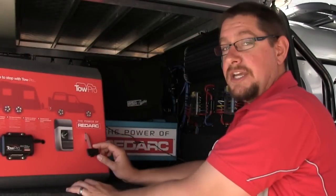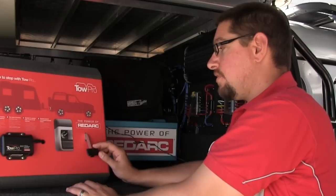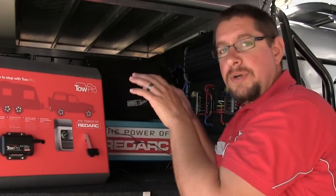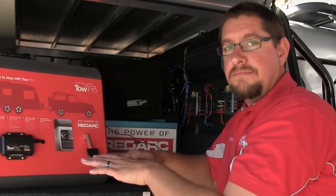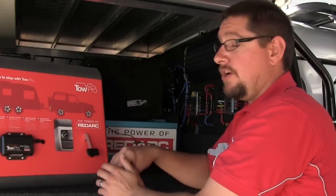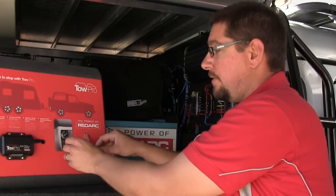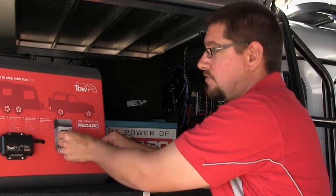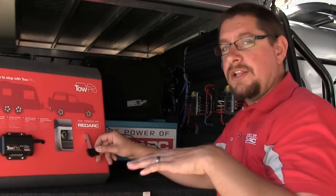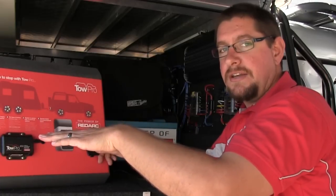In a soft beach sand driving situation, if we brake hard on soft sand, the vehicle bites into the sand. What we don't want is the trailer to bite into the sand as well, or we'll be anchored there. So we can set a very light amount of trailer braking force. You can brake as hard or as soft as you want with the vehicle, and the trailer will just glide to a stop on top of the sand.